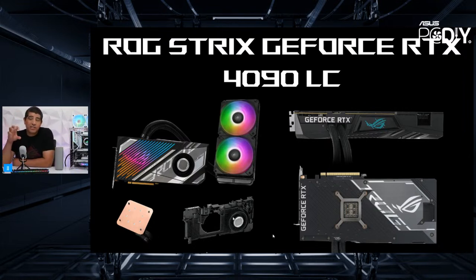And you can go into the GPU Tweak software to customize that. So if you want to set your own custom fan curves, you can do that. The max power target is going to be the same as it is for the ROG Strix and the TUF Gaming card, so you can go up to a max of 600 watts. You're pretty much going to be constrained, though, in that you're not going to be able to utilize that, because you are going to be more limited in terms of voltage than in terms of the max power limit. It is going to have the same factory clock speed programmed in as the ROG Strix card, and it will have a higher than default TGP. So that just means that the default power target on the card is higher than standard. The default is 450 watt, this is a 500 watt TGP, so it is essentially just a higher level of performance.